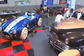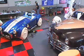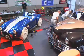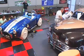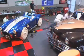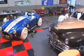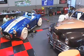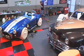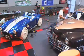And I know because about 6 or 7 years ago, I wrote an article, and when I wrote the article, I took a normal bathroom scale, it was accurate. I put a piece of clean, clear plastic on it so I could see the gauge, and then from experience, I put the polish on so it was lubricated, and I pushed down on it like I would if I was buffing on a car, and I took pictures and posted them to the internet. So I'm pretty sure, because the tool is about 5 pounds anyway, so just sitting there, you've got 5 pounds of pressure. You push on it 5 more pounds, that's 10 pounds of pressure. 10 pounds, you're at 15. People always think that's pretty high, but these paints are pretty hard.